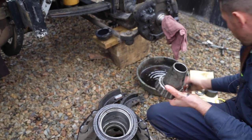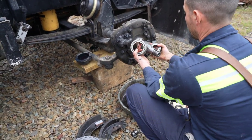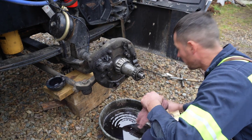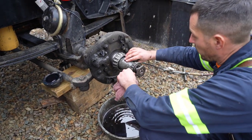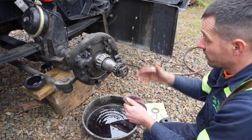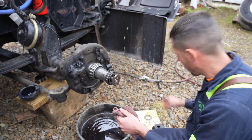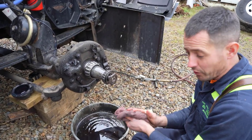This sleeve sits inside the hub and goes right over there — you'd have your inner nut, your locking device, then your outer nut, and it compresses everything. That's why you can torque it so high without affecting the actual bearings. But if you're not torquing it to spec, it's all going to be loose or could back off easier, and the sleeve could even turn. They have a proper procedure for these, and like I said, these plastic rings are what identify the hub type. I just wanted to clear that up.